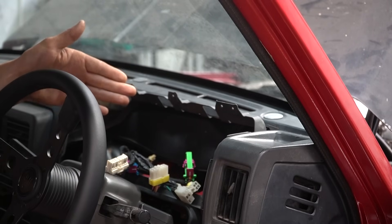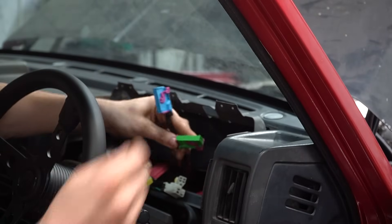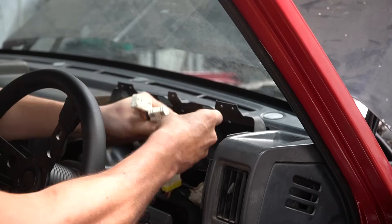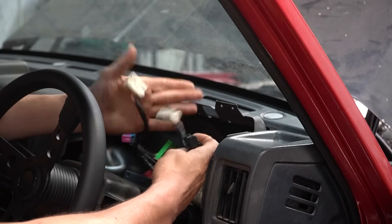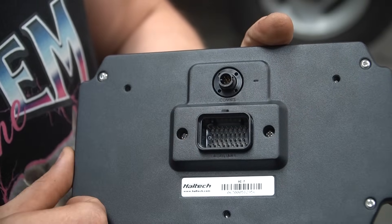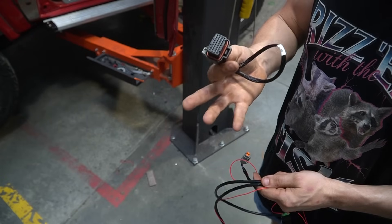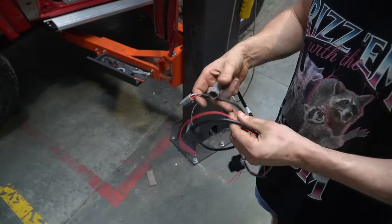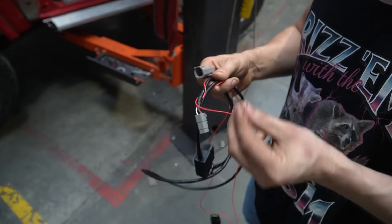Now, this is where the pre-planned convenience of this build sets in. Because seeing as I've got the Nissan Patrol wiring in here as well, what it means is I have these two connectors that connect to my Canbus Gateway and speedo that's going to be hidden away. And then I have these three connectors which are related to the dash cluster that was from the GQ Patrol, which obviously I'm not using. However, all I have to do from this side is find out which pin corresponds to the light I'm trying to activate and just pin it into that. So part of this episode is going to be a wiring exercise. I have these two cables — this one is the pin that goes from the dash to whatever I want, and the whatever I want is this OBD2 cable, which is independently powered. This will be powered from the same wire that powers the GQ dash so that whenever I turn it on, it'll also turn on the dash.